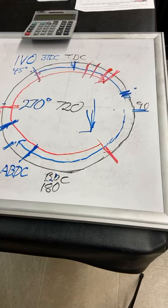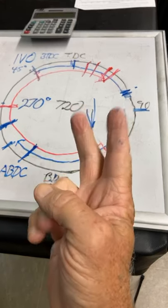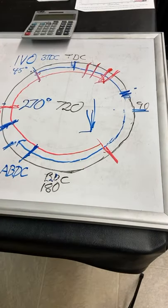And so we have Thrasher kits we do here. We take the 103 twin cams, we put a 107 kit in them. We have the 110 twin cam Screaming Eagle, and we put our 113 kit in it. There's several reasons why we use the sizes we use, and since we port the heads, we put the valves in, and we get the sizes of the ports and the compression ratio and the combustion chambers, we know what cam to use to get the result that the customer's looking for.